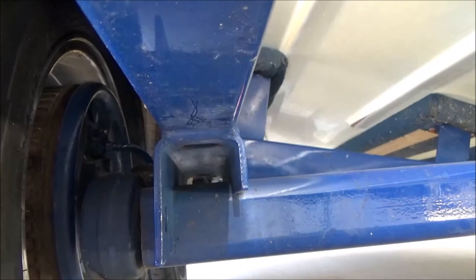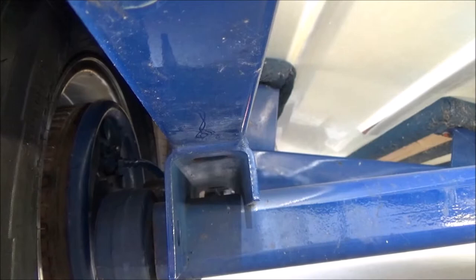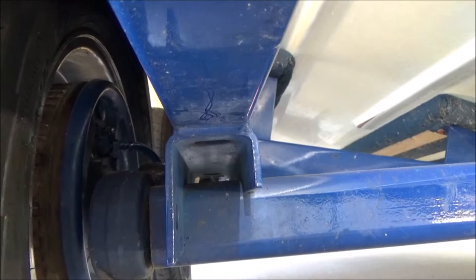So originally my thought was, and unfortunately this is all welded on, to grind off the welds and weld in a new piece of 2x2 tubing. This is all 3/16 inch wall. So to go weld in a 2x2, but then I started thinking, if I go up 2 inches, that's that much higher that I have to climb into the boat. It's that much deeper the truck needs to go, and the truck exhaust going underwater to launch the boat.